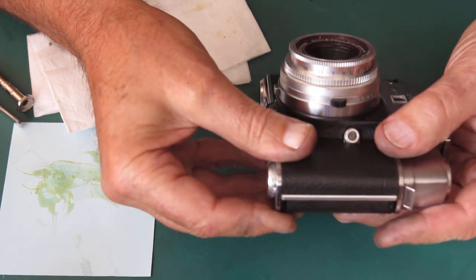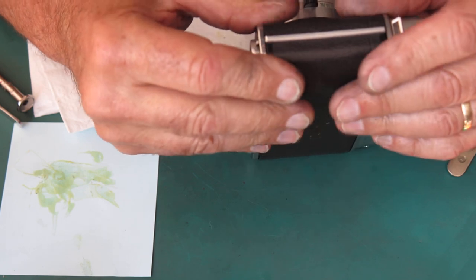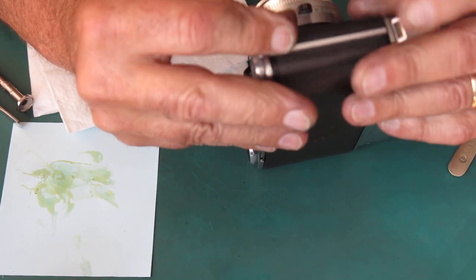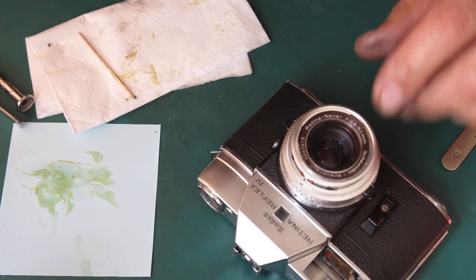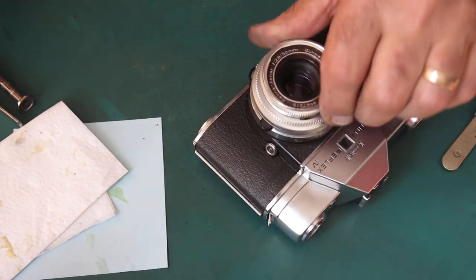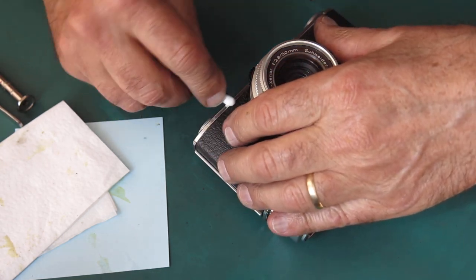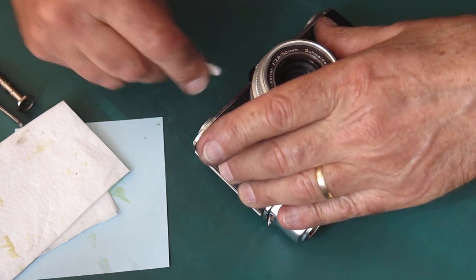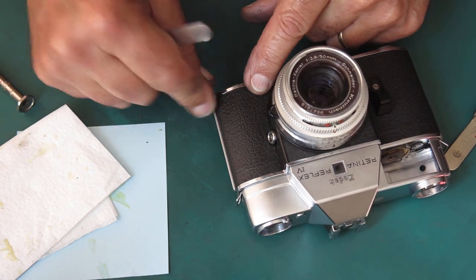Leatherettes normally shrink. You normally get a bit of a gap top and bottom. It's often a very small gap, but see that you get the Leatherette centered so that the gap is only a tiny gap top and bottom and not nice and snug at one side and a big gap at the other. That would catch your attention straight away.